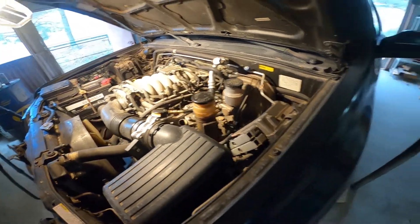Put the battery back on to see if the fuel pump kicks on. I got the tester here, we just thread it in. Alright, I got that all connected up. Keep an eye on that for me — I'll go turn the key. Are you watching? That was a couple good cranks — 150 holding steady. That's good news. Let's try the next one.